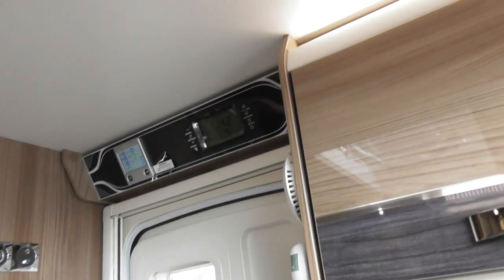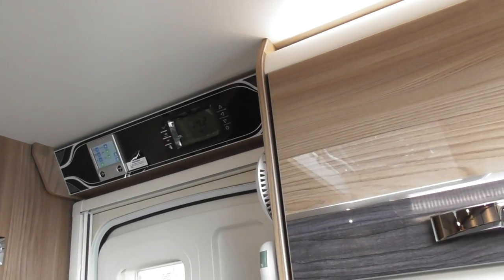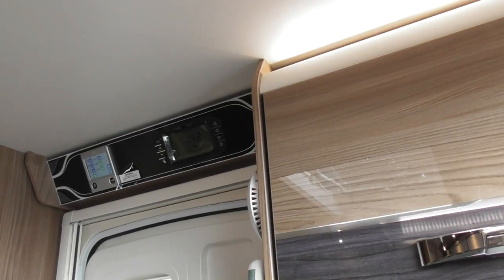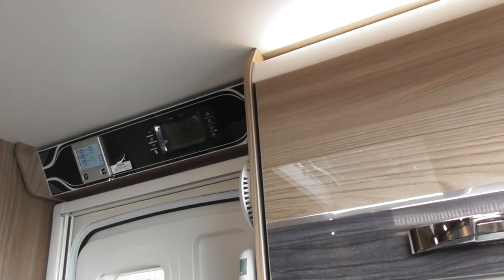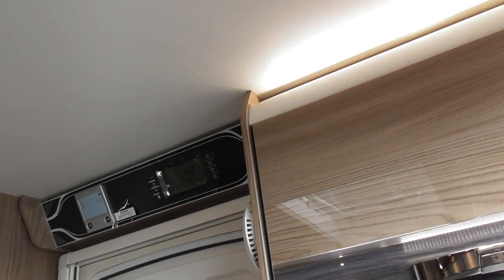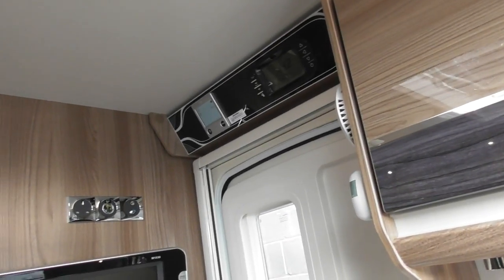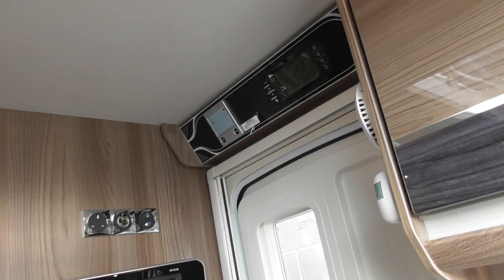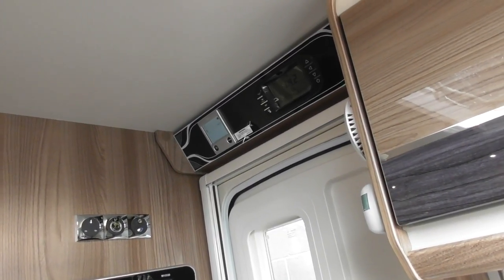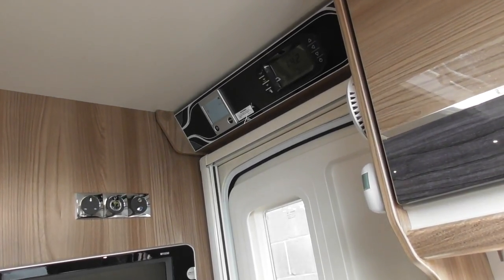It's quite a while since I've used the gas crossover. I just need to refresh my memory. Presumably I've got to switch both tanks on? Yes, or else it won't switch over. I then turn it to the one that's going to be first — your main one. It doesn't make any difference which is your main one, as long as it's pointing towards that one. So you decide — this is my main one I'm using, this one's going to be reserved. Then you swap to reserve, and you can change that one at any stage.